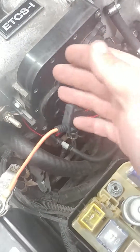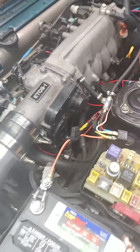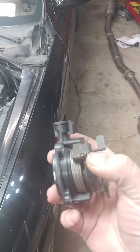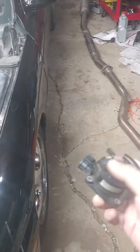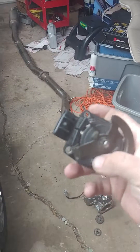When you take this cover off, you take the TPS off. There are going to be two gears in here — they look like this. You pull them out, put the cover back on, and put your TPS back on. The previous owner of this spare throttle body already did this mod and cut this here as well.